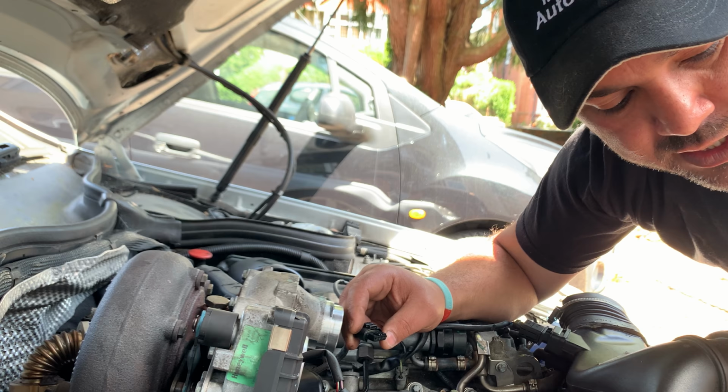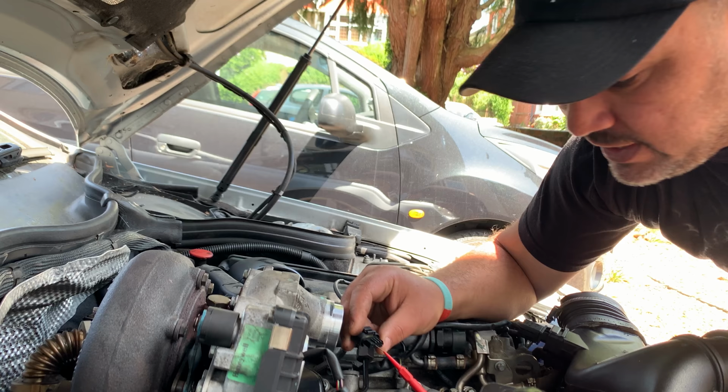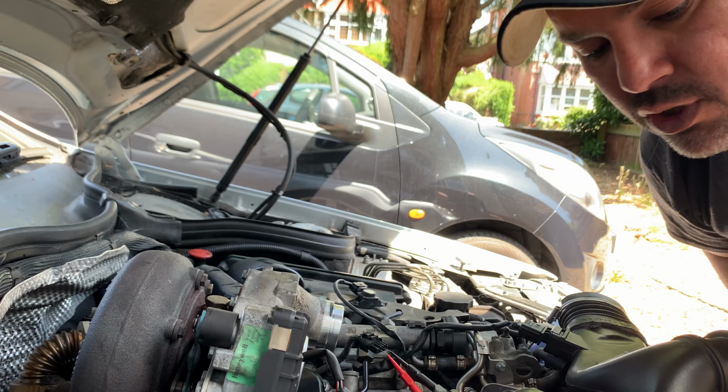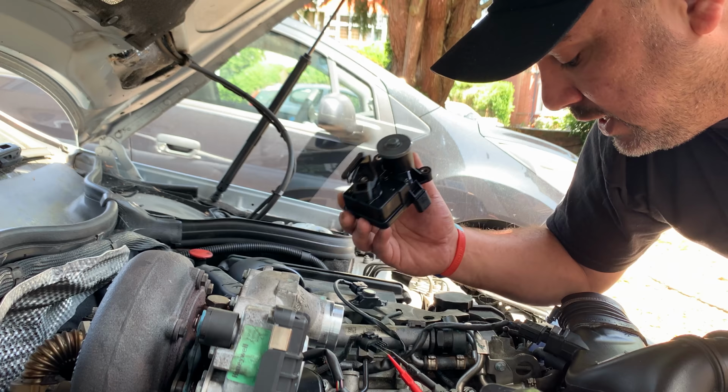just to make sure we have good wire. The wiring to the ECU is all good. So I've got my decade box here set up to 4.7K, and I'm gonna show you on the scanner now if we're gonna get rid of the fault or not. Well, I'm pretty sure I've got a new motor anyway, but it's the test that I did yesterday. This motor is basically gone.